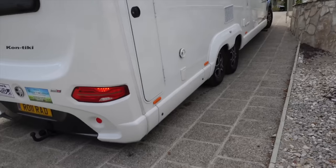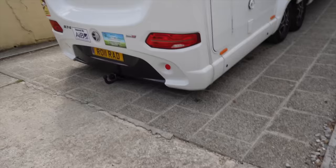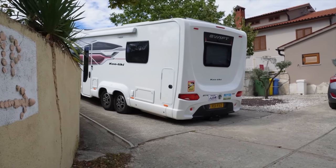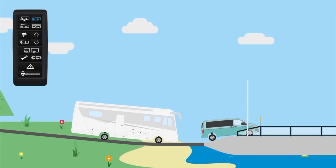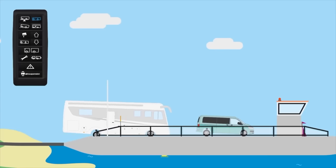The main reason we had our VBS suspension fitted was of course when we kept knocking water pipes off the back and bottoming out the tow bar. The tow bar was about to ground out. So right now we can push the button and drop the front and lift the rear when getting on and off ferries, which makes it much much better.